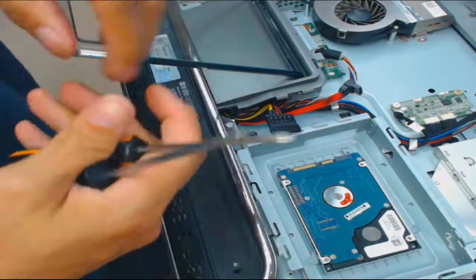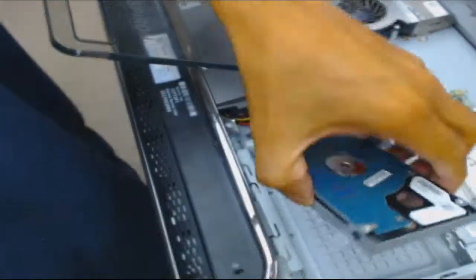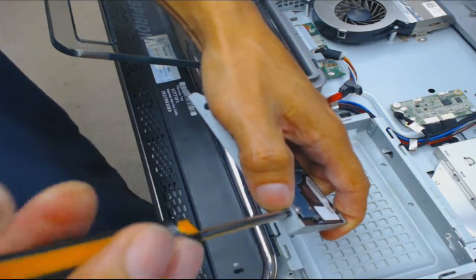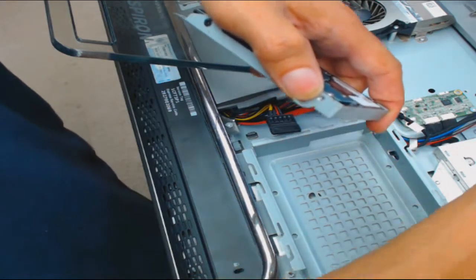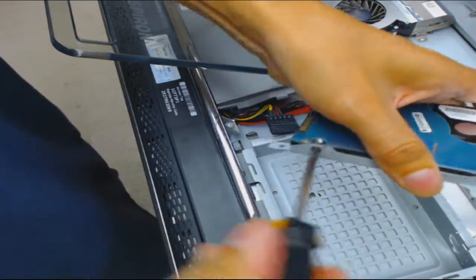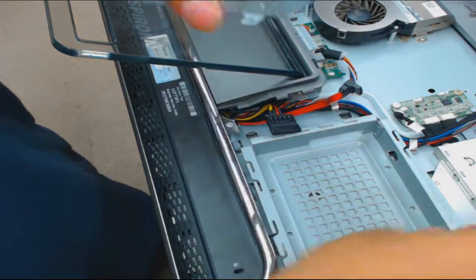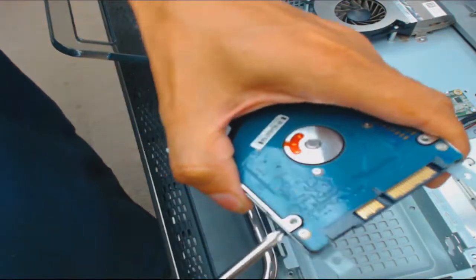This is all legitimate - all kinds of people mount laptop SATA hard drives into desktops or all-in-ones because the connectors are the same. This hard drive came from a laptop so it has a mounting bracket - I'll take that out and save the screws. I'm going to return the bracket to the customer in case she decides to have me replace the motherboard or put the drive back in the laptop.